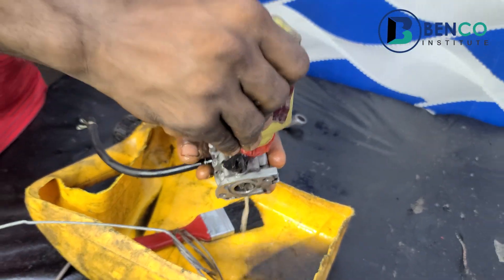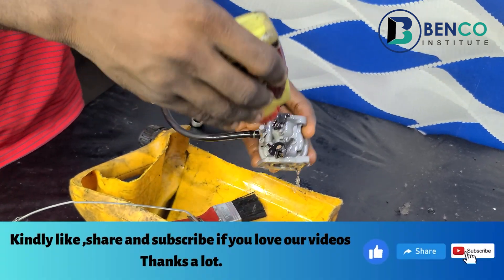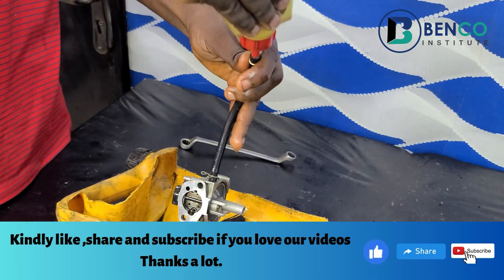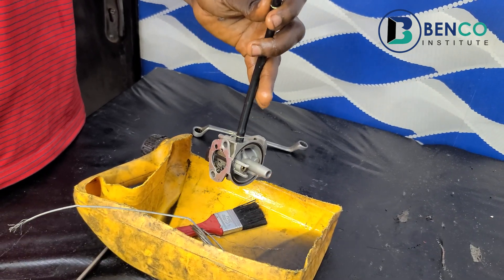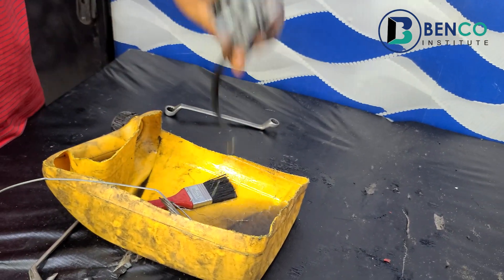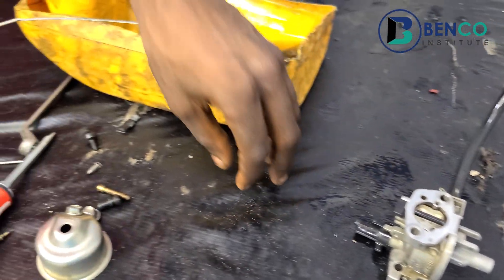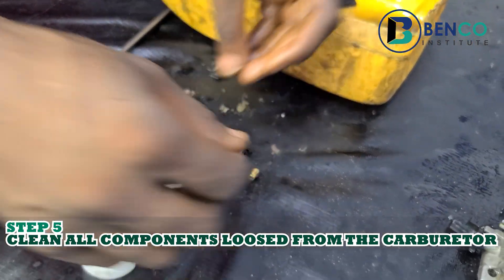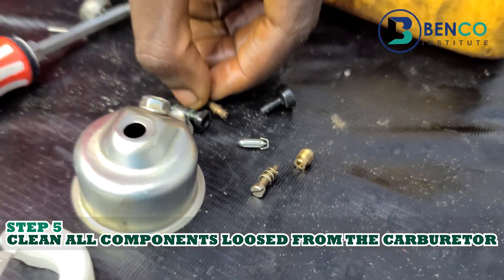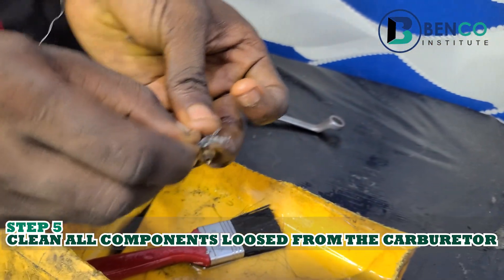You can see all pores are connected — we've done this successfully, blown through all the pores. We are done with this. We've washed this very well. The next step is to work on the components we took out from the carburetor earlier. You notice I said this particular one was dirty — you clean it as well.